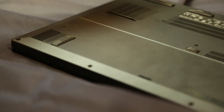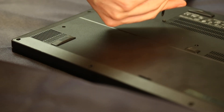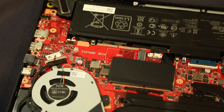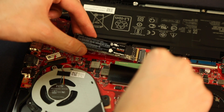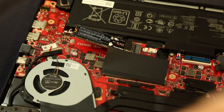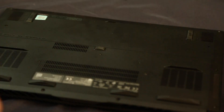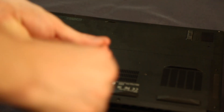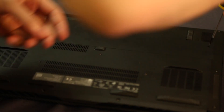Once you have this sorted, you'll need to remove the back cover of your laptop and find the spare M.2 slot on the motherboard. If you're replacing the existing drive, simply disconnect that and insert the new one. The drive should naturally incline on the board once connected and will need to be secured to the motherboard's mounting hole using an M.2 mounting screw. Once connected and screwed in, simply reattach the back of the laptop and boot it up. You should now have access to the second drive in your control panel and be able to use it for installing games or programs.